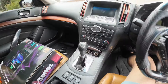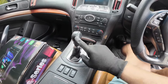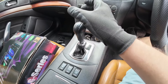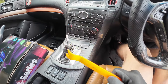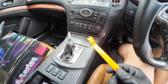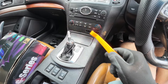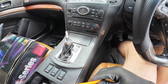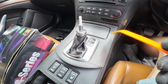Let's get it installed. I'll show you how to remove the trims of this type of dashboard and get this Nifty City Tesla-style screen installed. The first thing you're going to do is remove the gear knob shifter — drop this part, remove the pin outwards towards you, then slide the gear knob shifter upwards. If your Skyline or Infiniti G series is newer than 2010, you will need to remove an additional piece first.